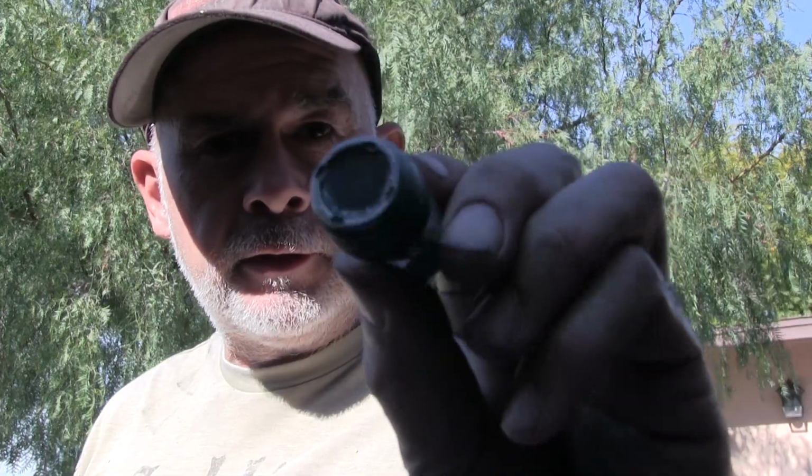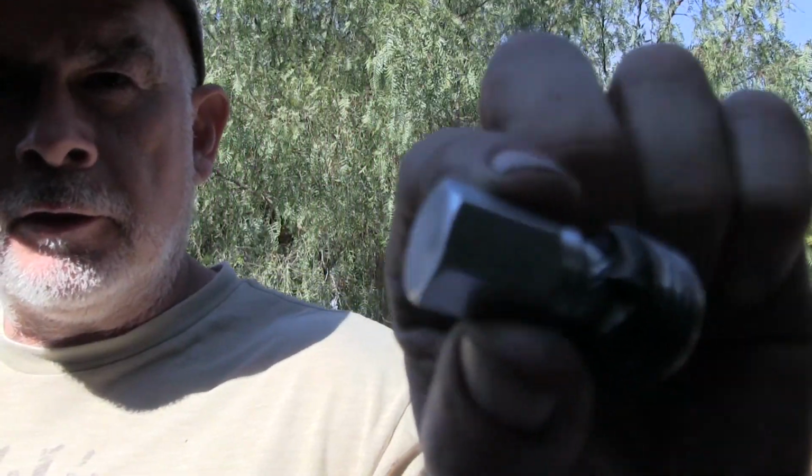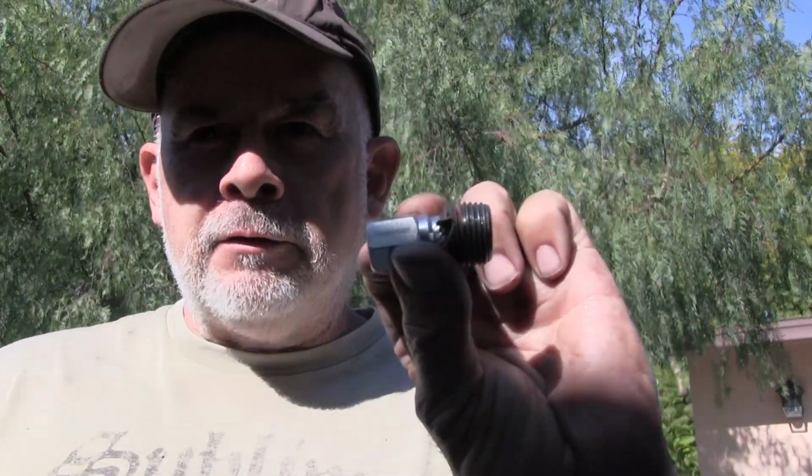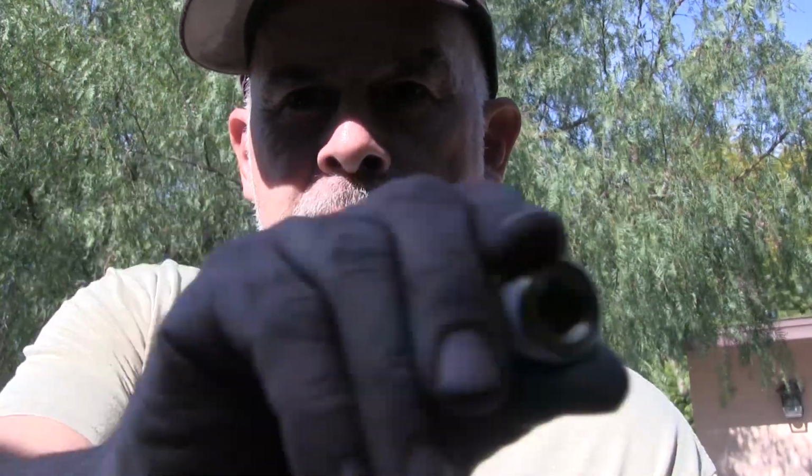So guys, this is the original drain plug. Oh, not the drain plug. It doesn't have a drain plug, it only has a fill plug. And that's my extractor. It's actually a pipe extractor, nipple extractor. Ask your old lady if she's ever used a nipple extractor before. So what I did is I just pounded it in there with my single jack, a little sledgehammer. I had to do it a couple times to get it to grip. Finally got it, and then it screwed out, luckily. But I can't find a new one. I probably could if I went shopping around or went to the parts store or wrecking yard, but I'm just going to put a regular brass pipe plug in there for now. Got it from the hardware store, Ace Hardware. Works for me. Gotta fill it full of oil now. Oh, hey guys. Back to the auto parts store, right?